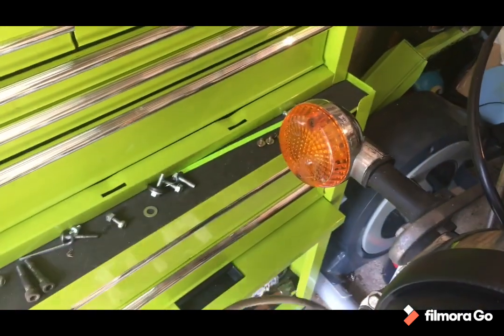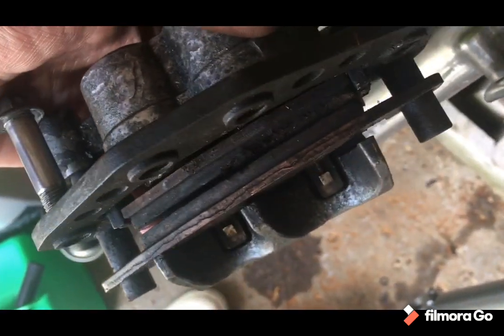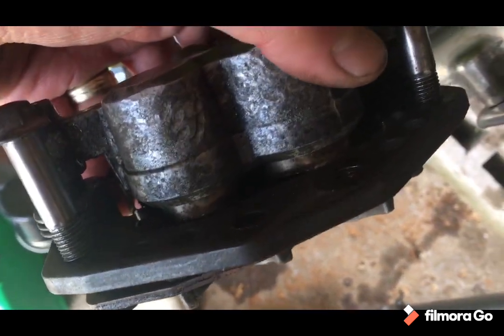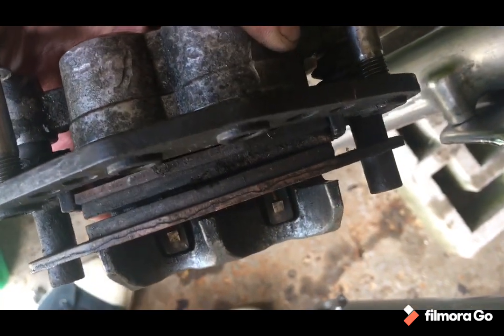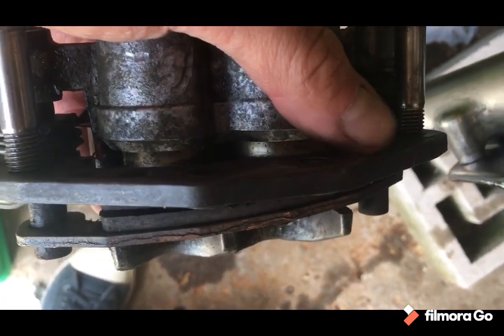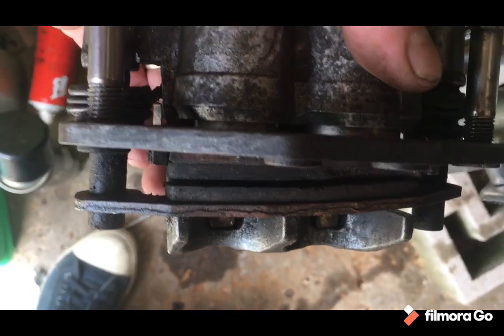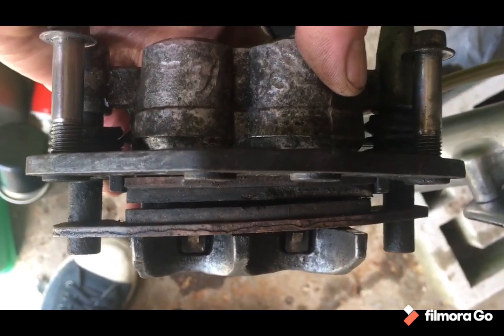While I'm thinking of it, I did have a quick look at the brakes - bear in mind this is quite spongy if you remember. Looking at the pads, there's a big chunk out of one, so we're going to need new pads. Looking at the pistons themselves I might get away with it, I might not. What I'll do is order some brake pads, and then potentially next weekend I'll dig the brakes out - not strip it completely, just pump those pistons out, give them a bit of a clean round and drop them back in.